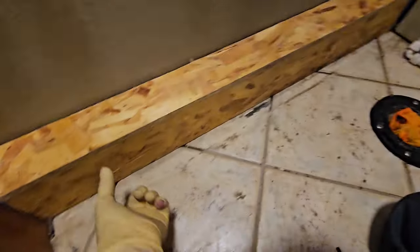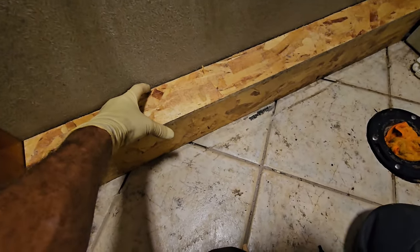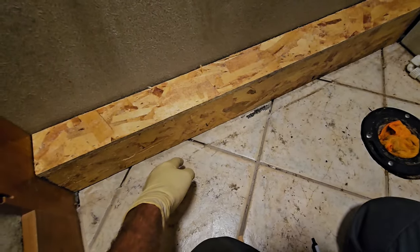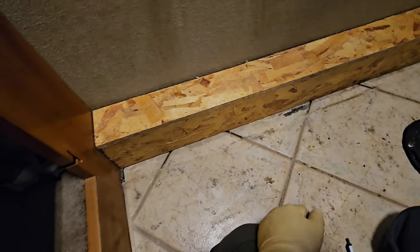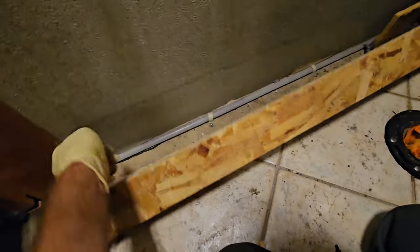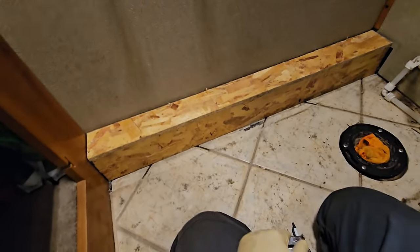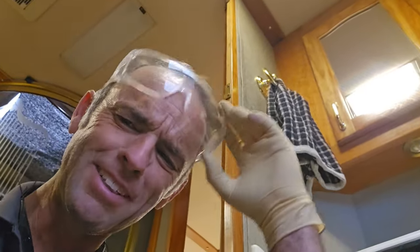All I'm going to do is rip a piece of that material right here, and then I'll go a little bit longer on the top so that it extends out, creates a ledge. I'll just put a bullnose router edge on it, and I'll screw this down into the wood here, and then we'll just glue down the Corian with some silicone. Really shouldn't be much to it, hopefully.